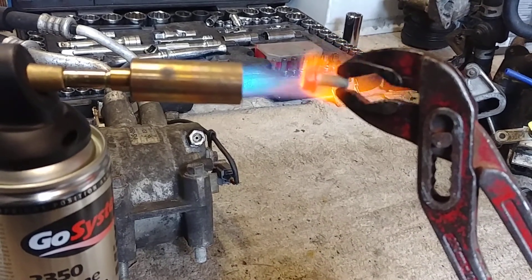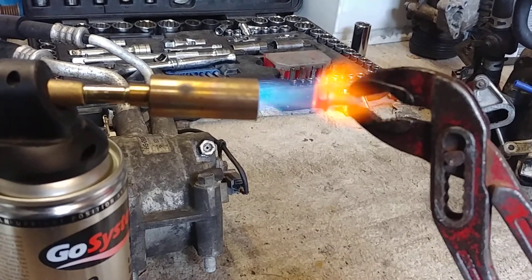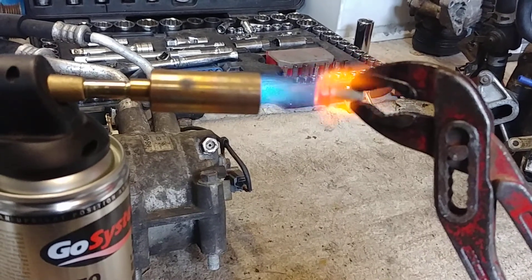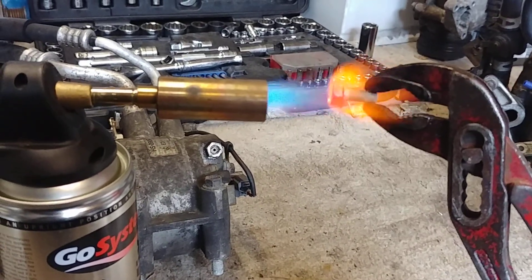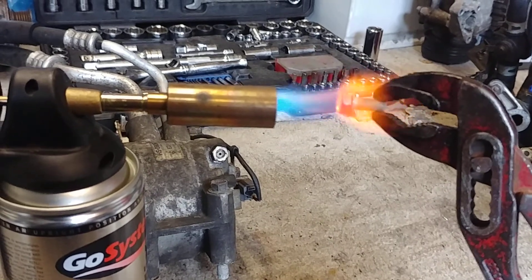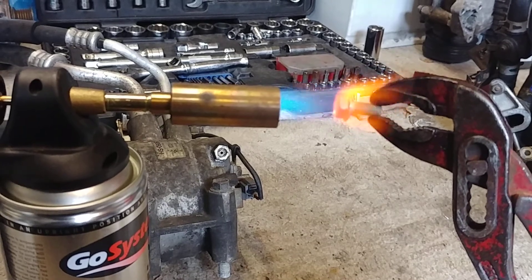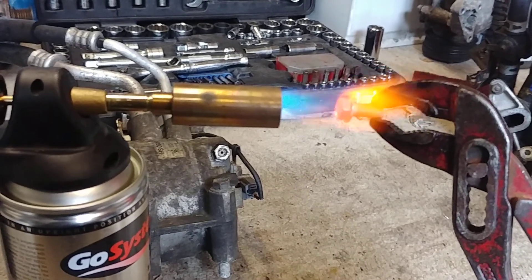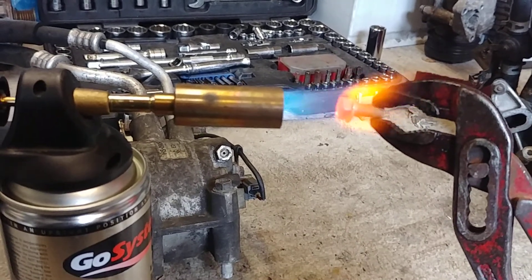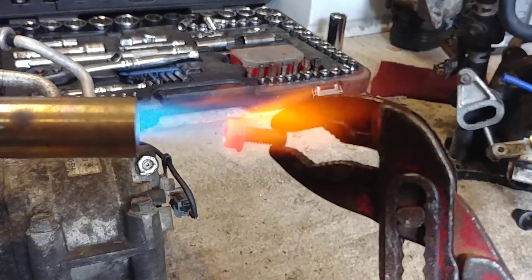All these little bolts, they're not what I call load-bearing bolts — they're all just fasteners for things like plate covers, alternator brackets, bracketry. Not really what you'd call critical load-bearing stuff, so I wouldn't do this on things like engine mounting bolts. It can affect the critical composition of the bolt and cause it to fatigue.